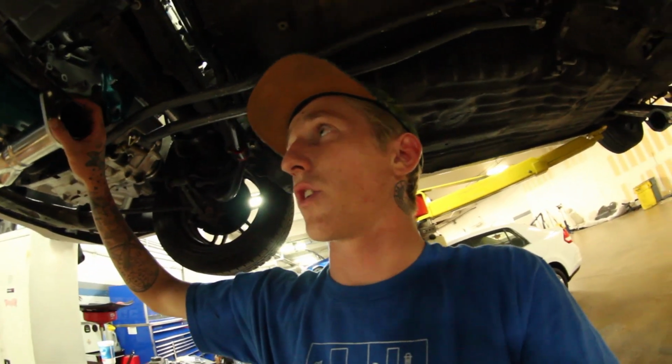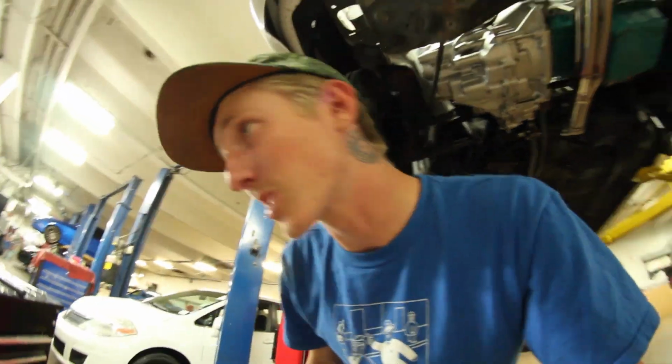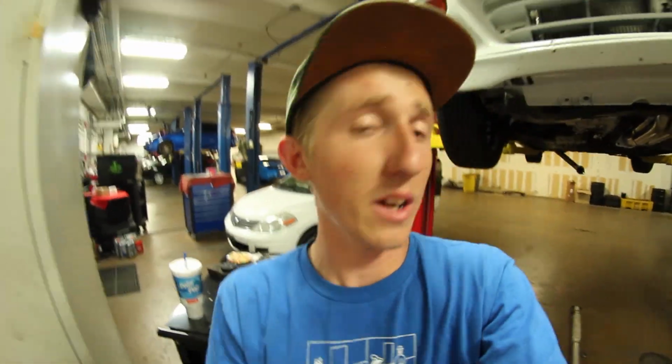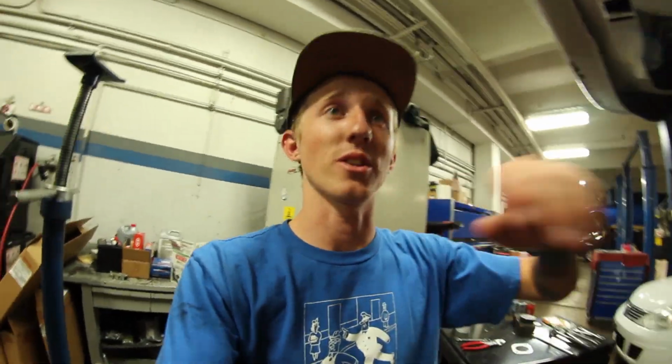So I'm going to have to drive home open headers, and then pretty much just park the car and figure it out from there. So I'm gonna get some measurements quick, and then I still gotta bleed the cooling system on here too, so I'm gonna lower it down, burp the radiator, and then find some earplugs so I can drive home tonight. But I mean, you guys wanted the header install. You didn't say nothing about the full exhaust, so I got you guys the header install. Although it sucks that I'm gonna be open header, I suppose it's better than having it not go on at all. Like, at least it fits, right? So I guess think positively, make the best of it.